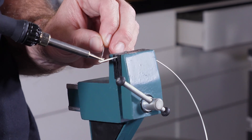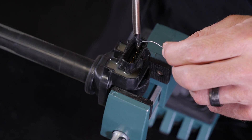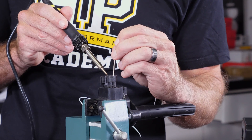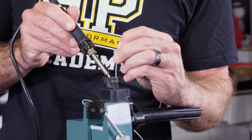If we bent the conductors after the tinning process, we'd be creating a strain point at the bend. Now we're going to use a soldering iron to tin the wire and the terminal, ensuring we don't apply excessive heat to the coil terminal. Next we can insert the wire into the coil body and solder it to the terminal, making sure we've got a good strong connection.